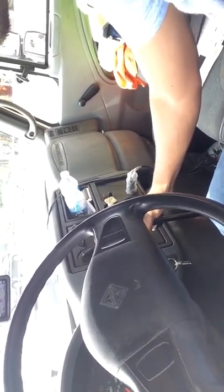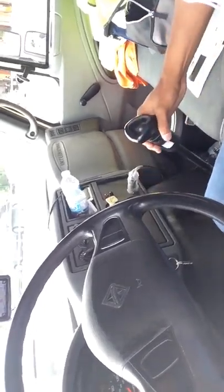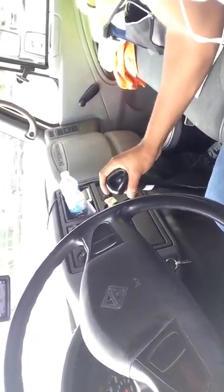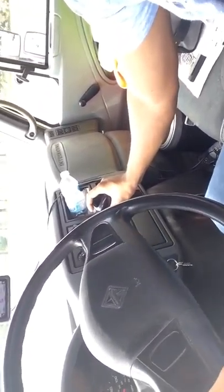So again, if you can see from here — one, clutch out, gas pedal in, clutch in, pull back, push to the middle, clutch out, clutch in, straight down, gas pedal down, accelerate. When the RPM gets to about 1500 RPM, I change around 15 — that's the sweet spot on this truck.